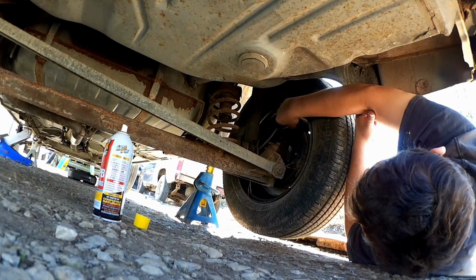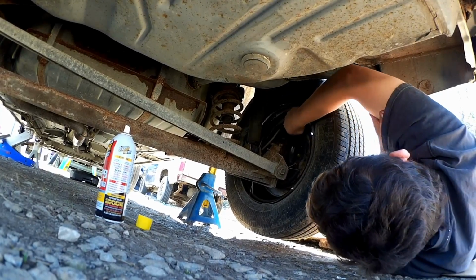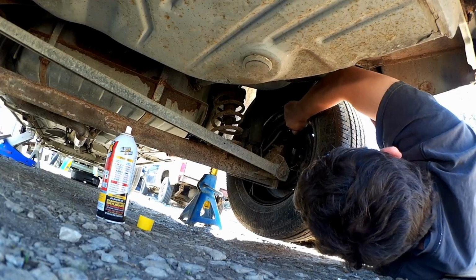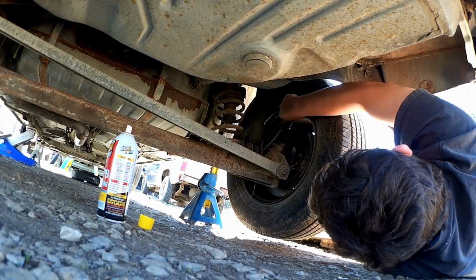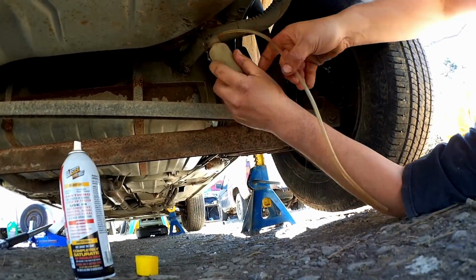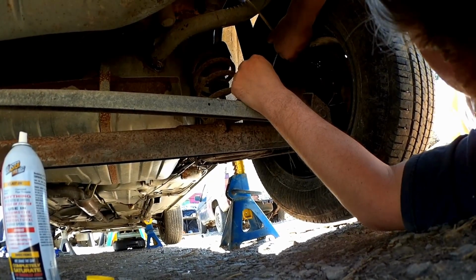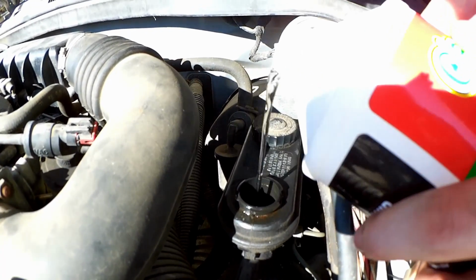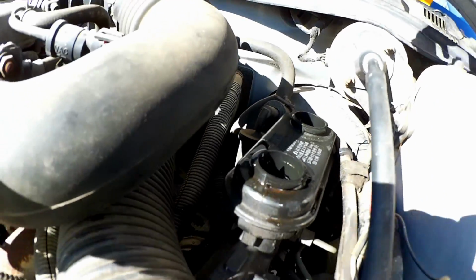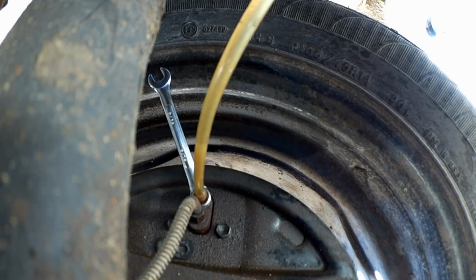Okay, so I need to get the bleeder valve open, and it's been soaking all night. Seems to be something near a 5/16. Oh, I think it moved. Oh, it's rotating without breaking off. We're lucky. The handy dandy magnetic mount bleeder bottle out again, so that the bubbles coming out immediately go up there, away from the valve, so they don't get sucked back in. Fill up the reservoir! Don't spill it everywhere. Holy shit, I didn't. But where's all that, was that liquid there before? Everywhere?